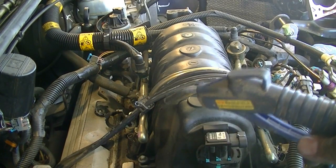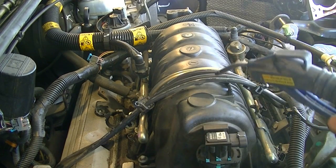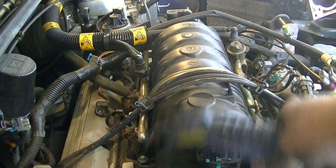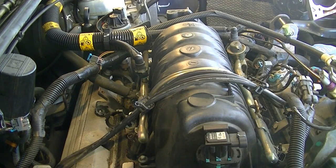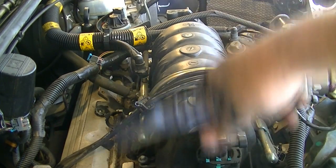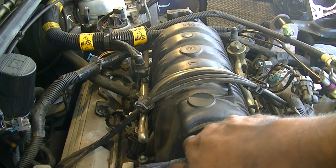Okay, actually before we remove our injectors and our fuel lines and then our intake manifold, you really need to clean all around those runners, because you don't want any junk getting in there, especially if it looks like something's been living there, as in our case. You can use a vacuum cleaner or some air. Just thoroughly clean it, make sure you air everything out and nothing ends up inside your engine.